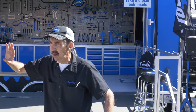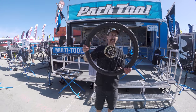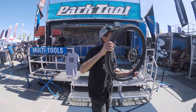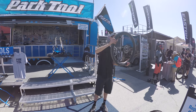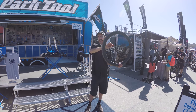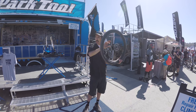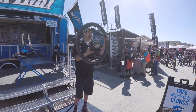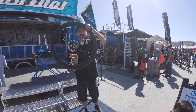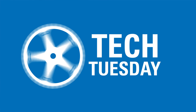Baseball is a pretty good game, great game, America's game. Three strikes in your wheel, guess what? It's not just bad luck. It's time for all new spokes. You get three broken spokes. You have one broken spoke, let's put one in. Big deal. It's easy to do. You break two spokes, take note of that. Third broken spoke, it's time. Time to relace. Thanks for watching.